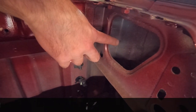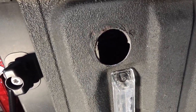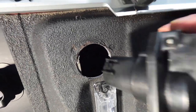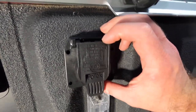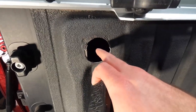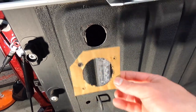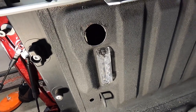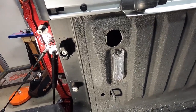We'll come through here and go straight up in there. It did jump a little bit — you'll see we got a little bit of walking when it went through and we hit a little bit of that plate right there. But that's okay. All we do is take that, slide it up to the left, make sure it's level, and we're golden. From the center of the hole to the left edge is 67 millimeters. But if you create your own template and line it off that left dimple, you're good to go. Let's take our 3/32 drill bit, punch some holes in there, plug it in, and we're done.